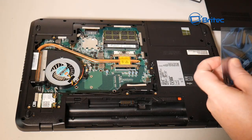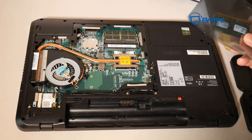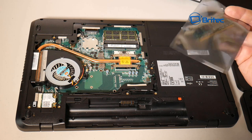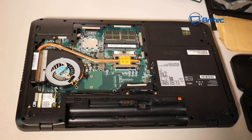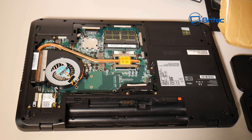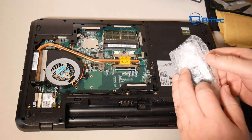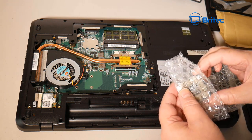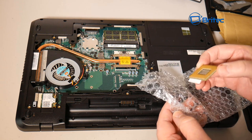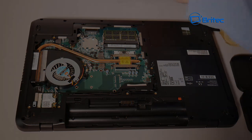You can see we can also get access to the CMOS and other parts just from this back panel. I've got some memory here to give it another lease of life. We're going to upgrade that CPU from the Pentium B960. Thankfully this has a G2 socket which allows us to do the swap. I don't know why manufacturers have moved away from sockets to surface-mounted CPUs — obviously they want you to buy new instead of upgrade.